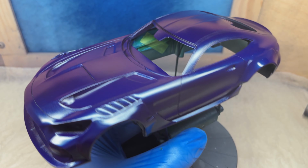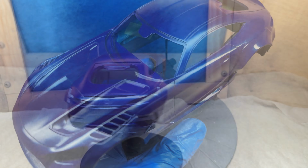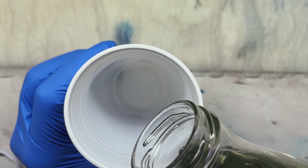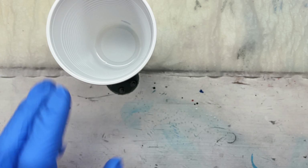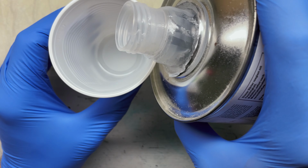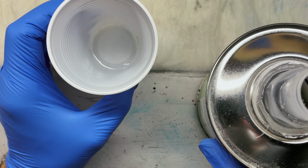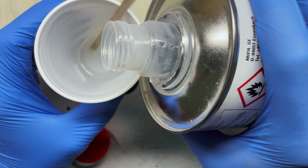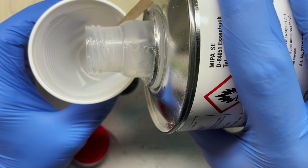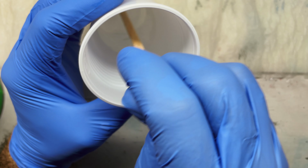So, finalizing the painting, we have a standard body on that. And now the lacquer layer is starting. I use the two component automotive varnish lacquer layer, which also uses hardener, so you need to mix one stage varnish and half stage hardener, and additionally you add thinner based on the ratio that you can spray out.